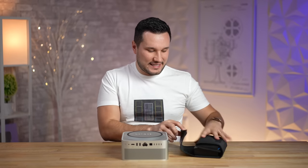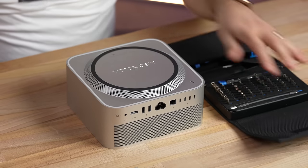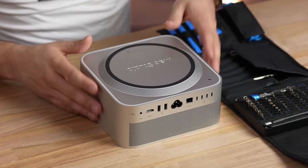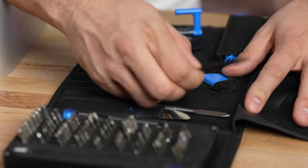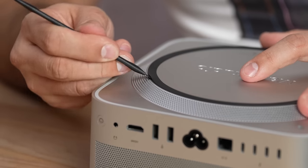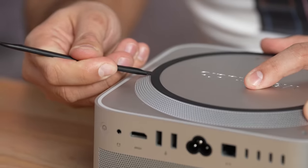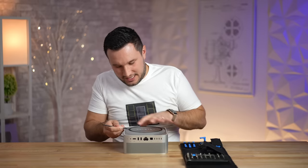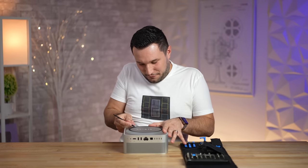We're pulling out our iFixit kit — not sponsored, but iFixit please reach out, we keep repping your tools. Grabbing a plastic spudger so it won't cause damage. It was hard to find a point to stick it in, but I got it at this edge and I'm slowly trying to get it unglued. I just felt something like a little dip, possibly for a screw — at least that's what we're hoping.